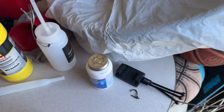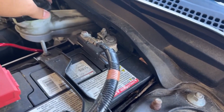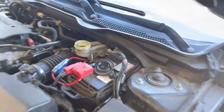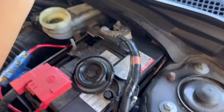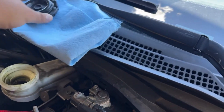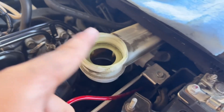You don't really need this — I'm just checking my brakes because of the mountain runs, and that's about it. Let's go ahead and jack up the fronts. Here's our brake master cylinder reservoir; as you can see it is quite dirty, green, black, and yucky. Grab some paper towels and put the reservoir cap somewhere safe up here, because I don't want any brake fluid touching any paint — it is a paint remover. Anyways, remove this and here's the fluid, all yucky and brown.